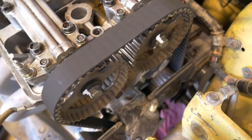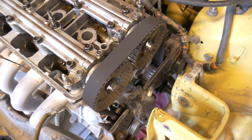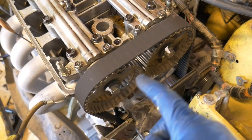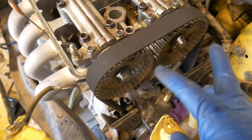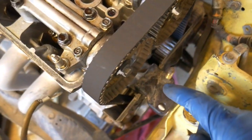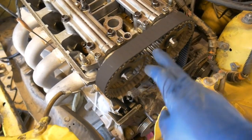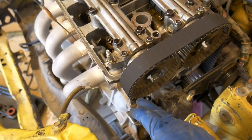So all those parts are finished. Went in and used some new paint, marked off the cam gear bolts, so if those move, I can tell in the future. I did torque them. Tensioners tightened, double checked, timing twice. It seems to be perfect. Removed all the slack from the belt.